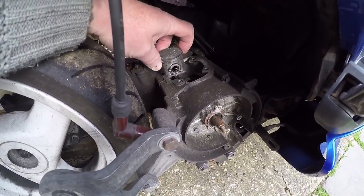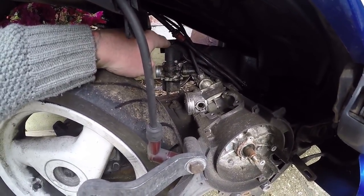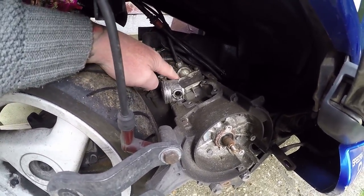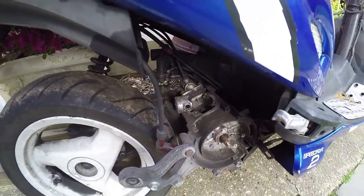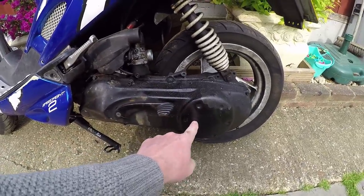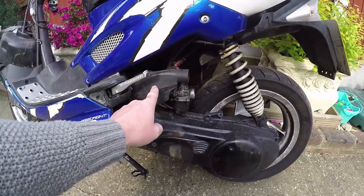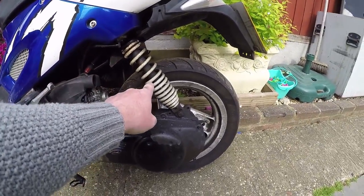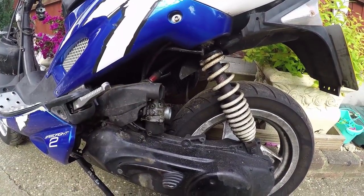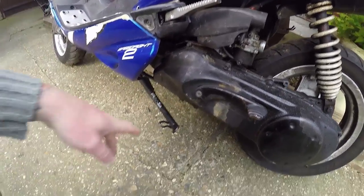Your big ends are here, these are your rings, this is the carburettor - I've done many videos on the carburettor, watch them. They will get all the bits and bobs done. The reeds are under here. Variator - I've done it many times before - variator, clutch, probably actually come off, and the belt's in there. This is the first link pipe of the airbox and the other airbox goes here. Rear suspension bolt, other bolt up there. This is the oil pipe that goes to the oil pump under here and leads back again.